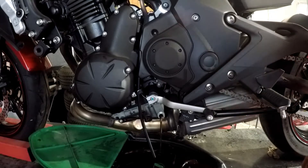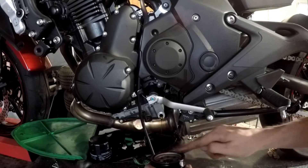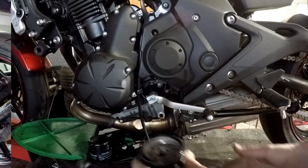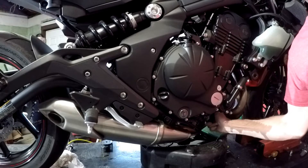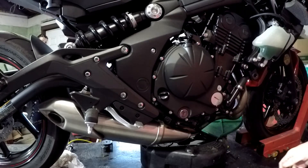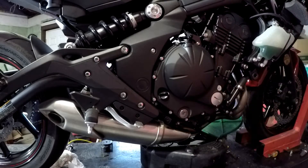There she flows. Don't forget to lube your gasket here, which I'm doing right now. I'll go ahead and put that on. Now we're on to the final piece of this oil change — always make sure the drain plug is tight, which it is. I have it cranked right down with a little bit more of a turn to it.